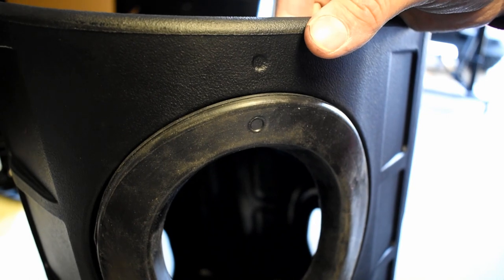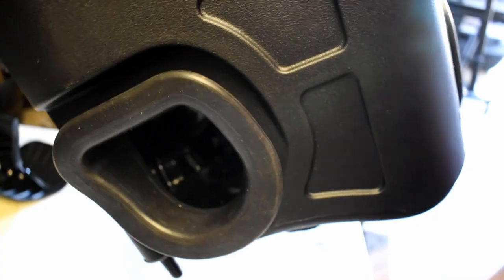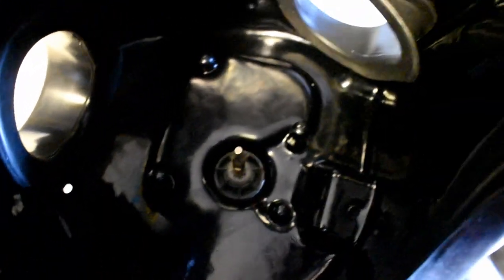I just had to do that process a second time because you're supposed to line up these holes — so remember to do that so you don't have to do it twice. Do the same with all the other ones as well. Now we're going to install this swing arm. See this flat side right here? This little notch needs to go on the flat side — those need to line up. The other side is just kind of round and normal, and this side is flat, so those two need to match up.